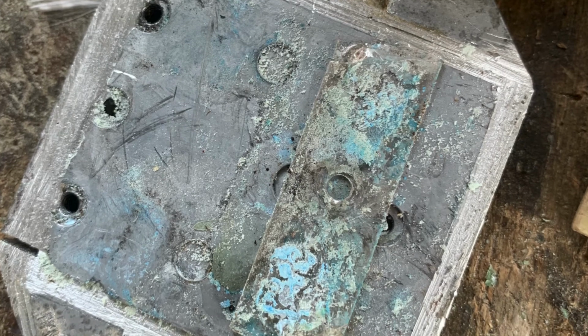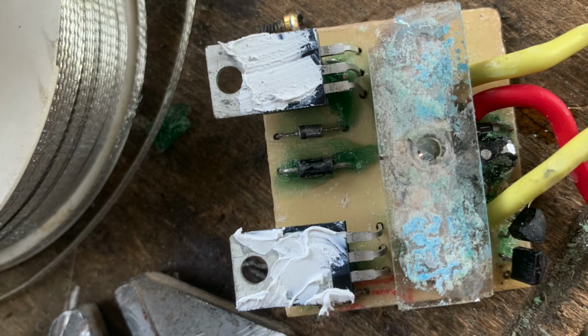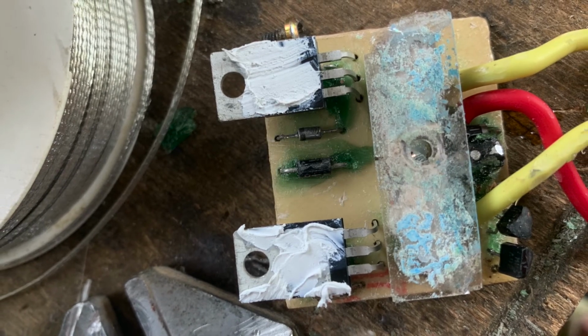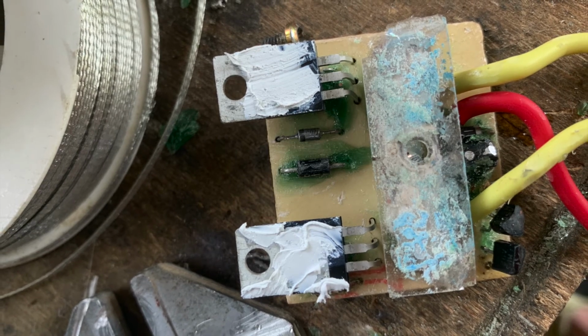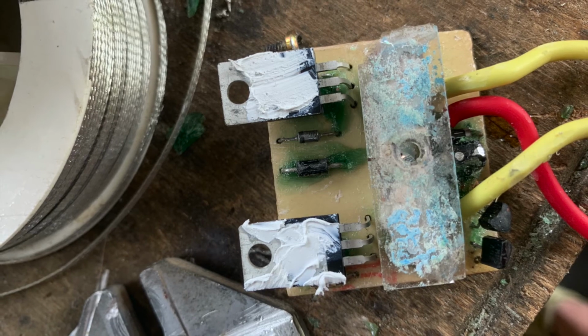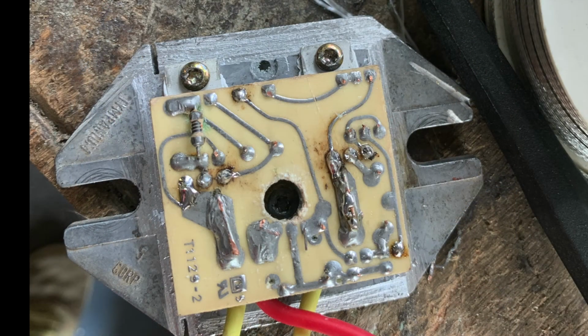All of the backs of the 2 major components are coated with silicon heat transfer paste. In the case of the center device, this is insulated from the main chassis with a piece of mica, and both sides of the mica were coated liberally with the heat transfer paste, and then everything was firmly screwed back together and taken to be tested.